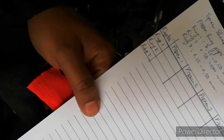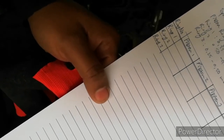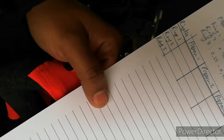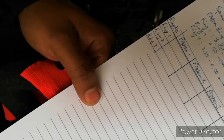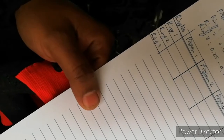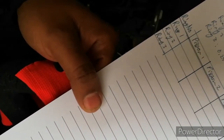I've just gotten my spec sheet so that I know more or less what the tolerance should be and what it is at the moment. I'm just going to use this to record all my values that I've found for each piston ring, and then we'll go ahead and grind them down if they're too big, and then we'll reinstall and double check it.